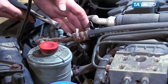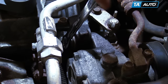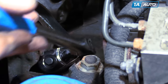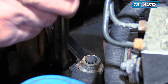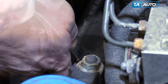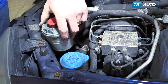Make sure you tighten up this nut, then tighten up the bottom 12 millimeter bolt that holds it. Tighten up the top 12 millimeter nut and then tighten up this 12 millimeter bolt. Getting the wrench on there is half the battle. Put your reservoir back in place.